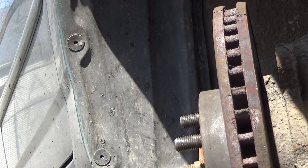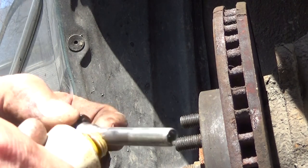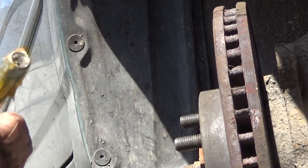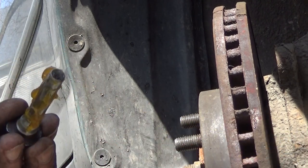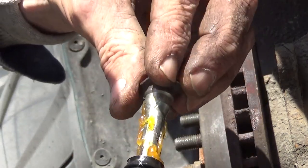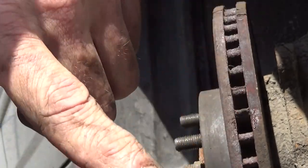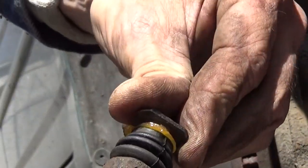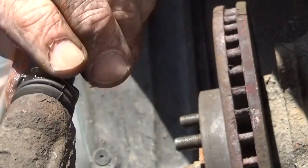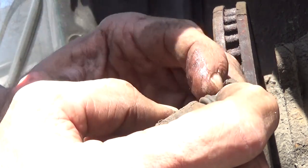Now we're gonna grab our silicone grease, Siliglide, not a sponsor. Put some of that on the pin. Don't have to go too nuts with it. Make sure you got it up around the top here. And slide your pin back down in, and rotate it as you're going back down in. It helps evenly distribute the grease, and it helps make sure that you've got grease coming up around the top here, which is going to help provide a seal on the top of that boot so that it doesn't go rusting up on you again. And the other side, I'm gonna pop this off, clean this one up as well, just to play it safe.